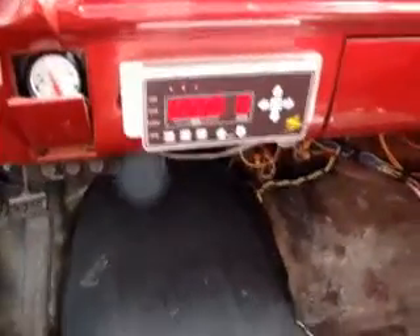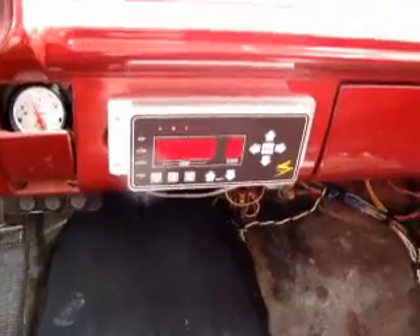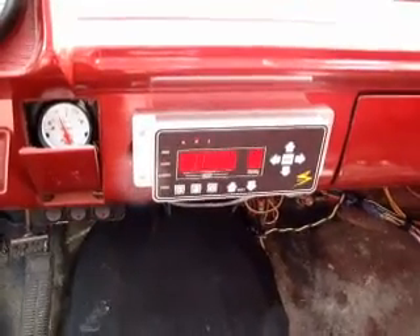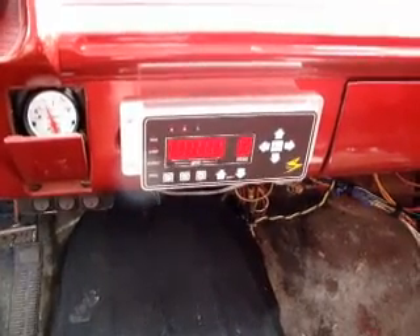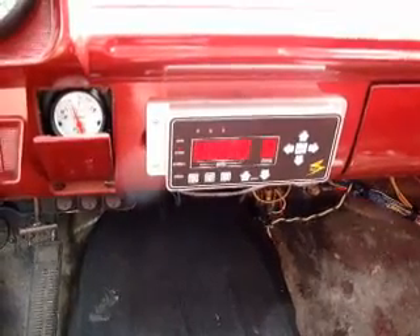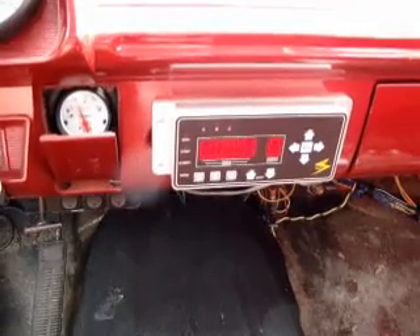The feature is that if the motor actually stalls going down the track or locks up immediately, this immediately goes into neutral and you won't roll the car or barrel roll the car, because the car will freewheel. So that's another major safety feature. It also has outputs to turn the reverse lights on, and a block-out for neutral if you want to not be able to start in neutral — it also has that feature.